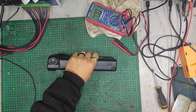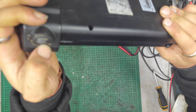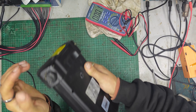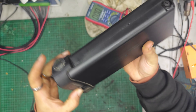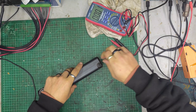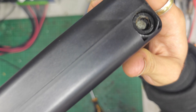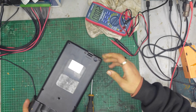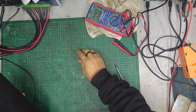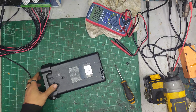I've got in today an eLife Regency electric bike. It's a little folding electric bike and what we've got is not a lot of output from the battery it would seem. It turned on a minute ago, then I tried to undo the fuse holder and the top just snapped off the fuse holder. Inside it, look at that — it looks all horrible and melty. So the problem with the bike, basically the bike's not turning on, and it could well be this melty thing we have going on here. So let's pop the battery open and have a little look.